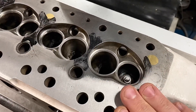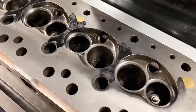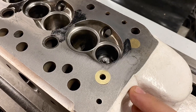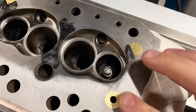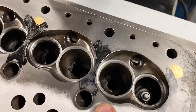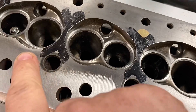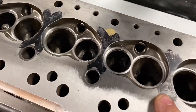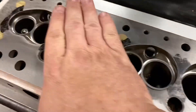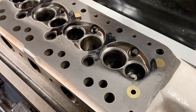Unfortunately, the bottom face — this is a worked head that's been worked by someone else — has already been machined on an angle. And also, just because it has been worked before doesn't mean to say that it's actually flat. So if you look there, you'll see we've already got a moving surface. This one needs a cursory skim before I can even continue with the machining.